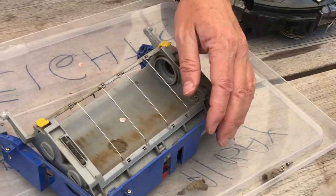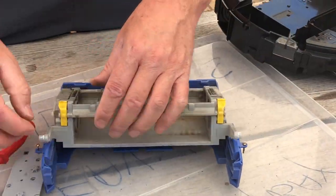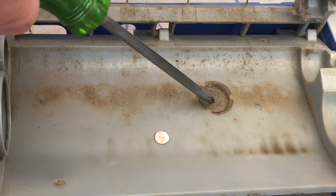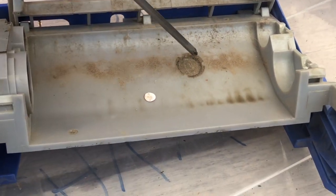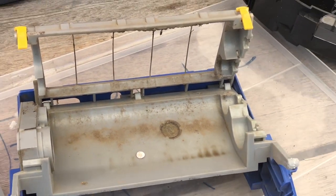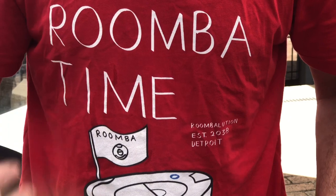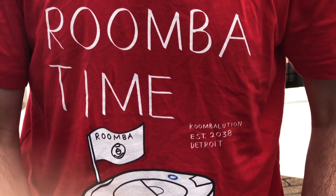So there you have it — your CHM is all maintained. I also recommend giving this a good clean. This sensor here is the dirt detect sensor. I wouldn't recommend removing it and trying to clean it; I would just use some contact cleaner with a toothbrush to give that a good clean, as it's quite fragile if you try to remove the sensor. I hope you got something out of this video. I'll be posting more videos on maintaining some of the other motors and also troubleshooting the Roomba with a laptop. Thanks for watching.